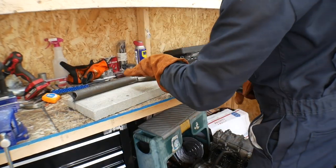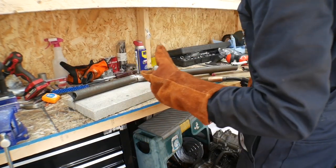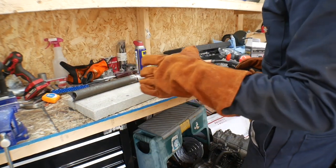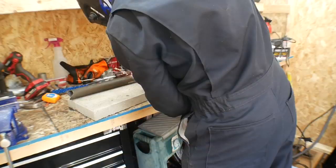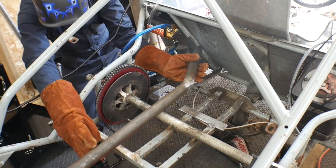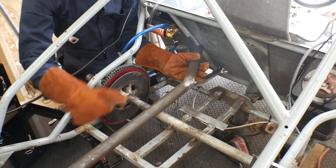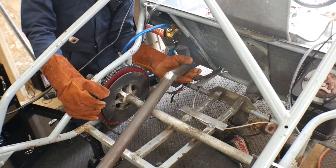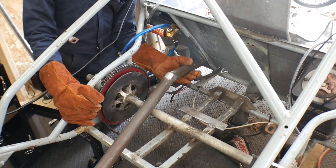I've got everything on, so I'm going to do quick little tacks on the bottom and top — I'm eyeballing this, so if it's off I can break it apart and redo it. It's hard to align them when they're not on the car. After tacking, I got eye-level with it — that looks really good, nice and horizontal. I'm resting it on the axle as a way to keep it even. Now I'm going to weld this thing up. This is my first serious welding on a tube and on an angle like this, so I'm going to take my time.